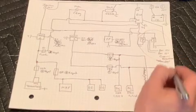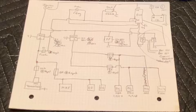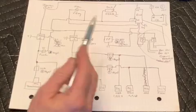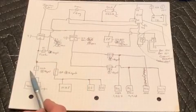And then all of that, basically those relays should be pretty close to the fans, or you could have a full relay control circuit from some third-party aftermarket company. All of that will be under the hood though. And then I tend to use circuit breakers on fans and stuff like that so that they will auto reset if one does happen to pop. You don't have to actually go out and change a fuse to get the fan working again.